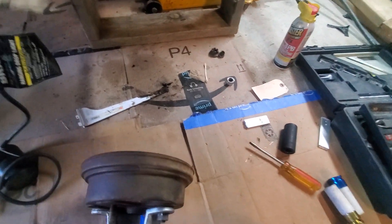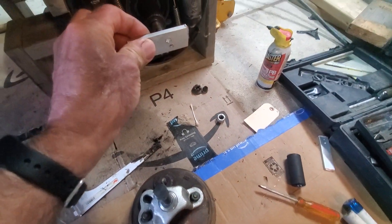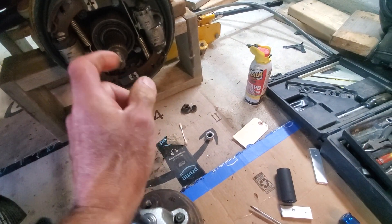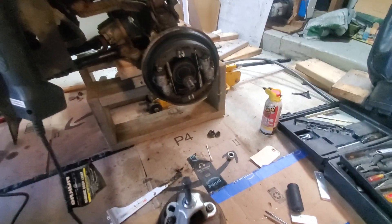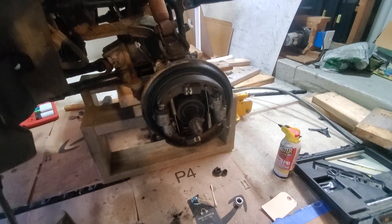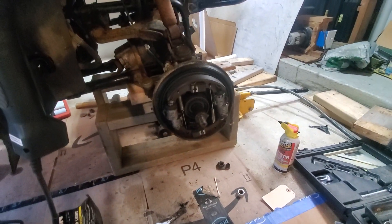Last time I mushroomed this by letting the sharp tip on this push directly. I actually put a piece of metal in between and put the castle nut on too to prevent that outward pushing and mushrooming. That was a son of a bitch on the back axle — I ruined it and had to buy a special split reverse threader to re-thread it so I didn't have to change the whole axle.